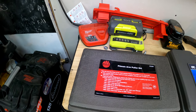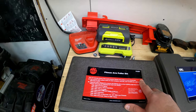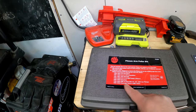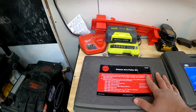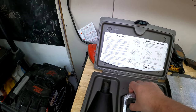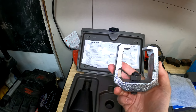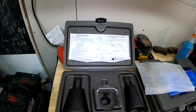This kit I bought off eBay for about $180. It's MAC tools part number PA301. If I can find a link I'll put it in the description. It does the Navigator, the F-150, and some GM stuff — Suburban, S10, all that. This is a nice kit to have but it's definitely more pricey. The reason for this kit is because this puller is very beefy compared to the cheapo Harbor Freight parts store ones. This one is low profile so we should be able to pull our pitman arm while the power steering box is still in the truck.